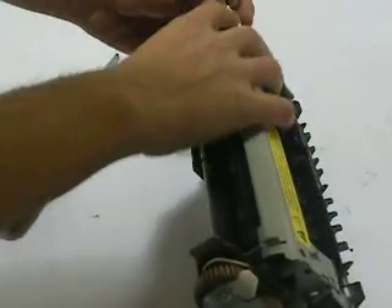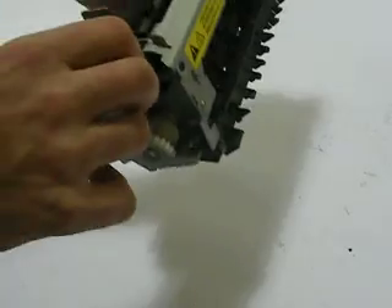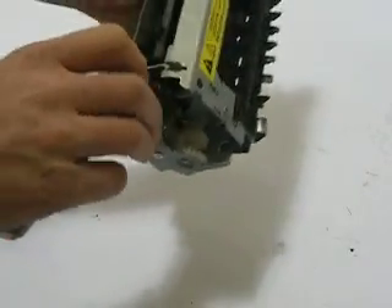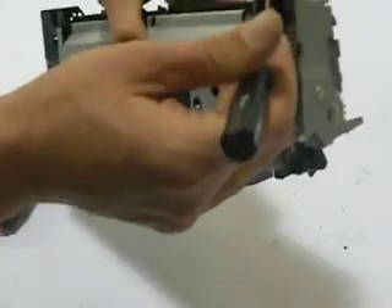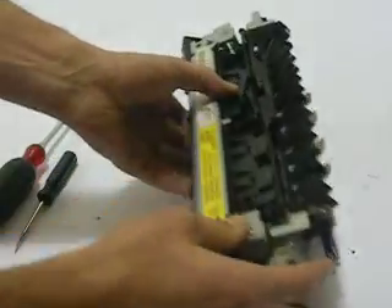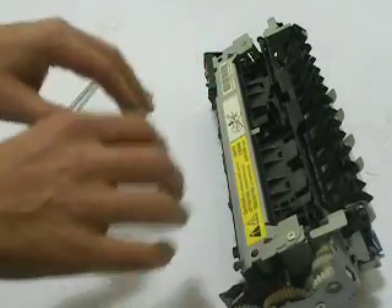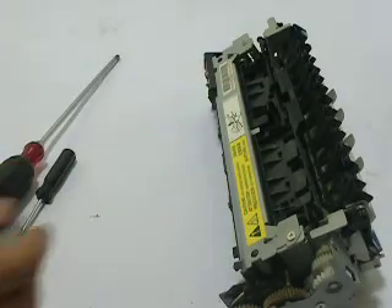While you have the lubricant, you can wipe off any excess when you're done. Right now you can turn your sleeve and see how it's spinning — and this one's spinning real nice. Make sure your connectors are in on both sides, and of course make sure this connector right here is plugged in nicely. Go ahead and reinstall it in the printer and run yourself 20 or 30 pages, and you'll find that this is a real easy repair. We sell this sleeve plus the lubricant on brokenprinter.com, and we also sell the whole fuser too. I hope this was helpful for you today. Thanks.